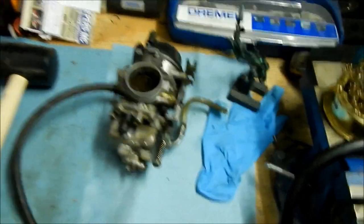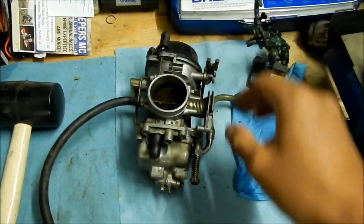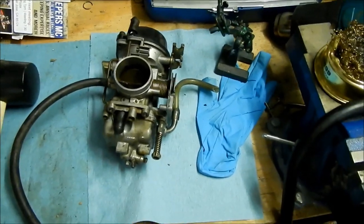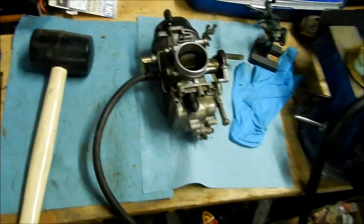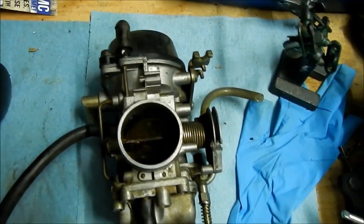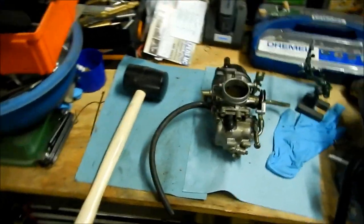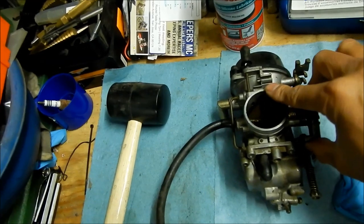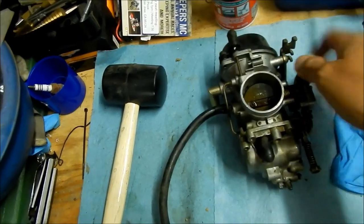I got it here on the bench and I tried hitting it with a rubber hammer on the throttle cam, and it opens — I got it to open — but it doesn't snap back. It's not smooth, that's for sure. We're probably going to have to take the whole throttle thing out and clean it. But I've already sprayed it with carb cleaner, so maybe I'll spray some silicone lubricant in there. I sprayed some heavy duty silicone lubricant in there and it's moving a little bit easier — that's good. I'm just going to keep working it and it'll start moving on its own.